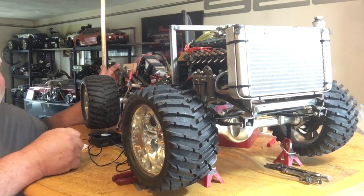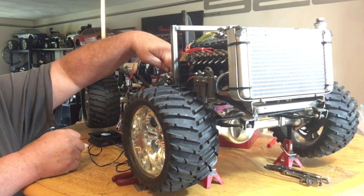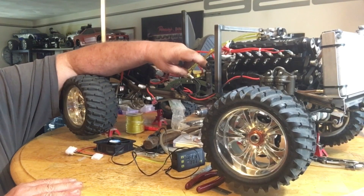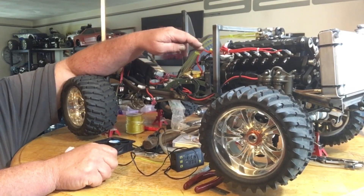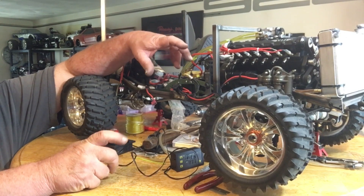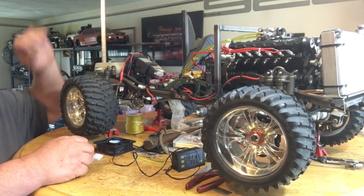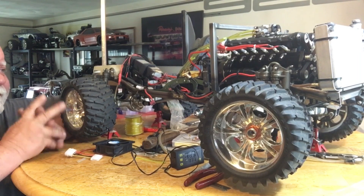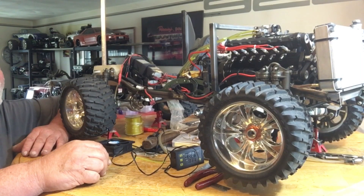You're going to see it in video — you're going to see me hold the gearbox brakes. The gearbox on the Colossus has brakes front and back on each drive shaft, and the clutch needs a little more adjustment. This is a bunch of parts from like the B5, the Rovan, the Sen — and I had a couple of pieces of eighth-inch square aluminum that I made an adapter plate for the clutch to fit. I was only running first gear and reverse, so you're not going to see a tremendous amount of wheel speed, but it does pick up pretty good.